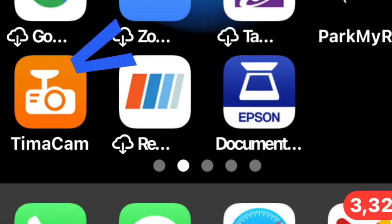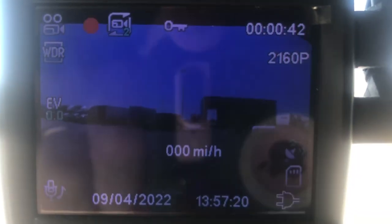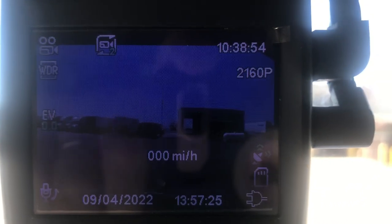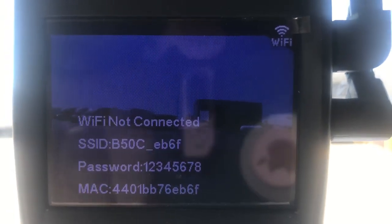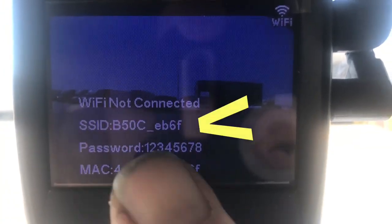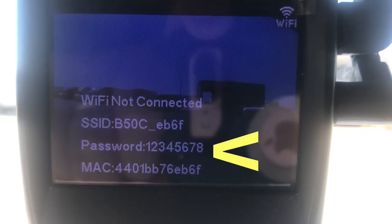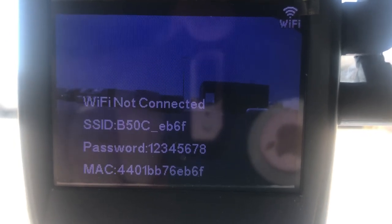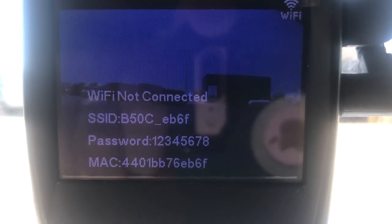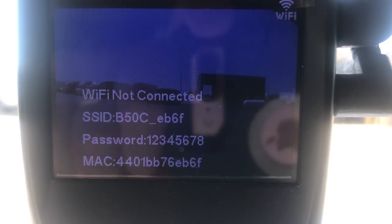Here's what it looks like. You open that up, and now I'll walk you through that process. If you want to do it over Wi-Fi, first again you need to stop the recording. Then you can just hold down the OK button while you see that little camera icon. Then it says Wi-Fi not connected, and it gives you the name it's going to have — that B5-0 thing — and gives you the password. So now you go to your phone, go to Settings, open Wi-Fi, look for that B5-0 or whatever it is on your camera. Click on that, it'll put in the password, and then you're going to be able to connect.